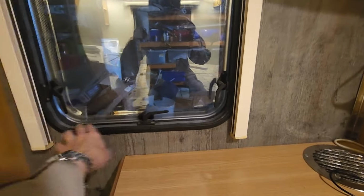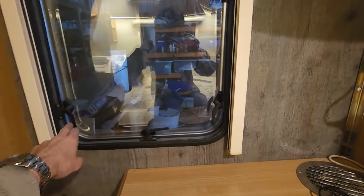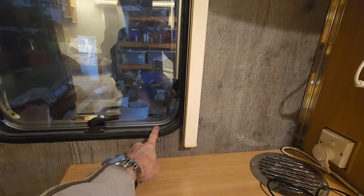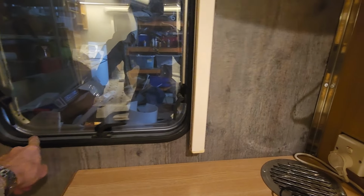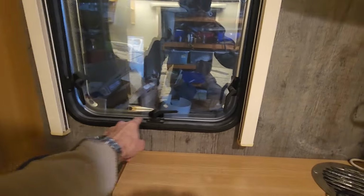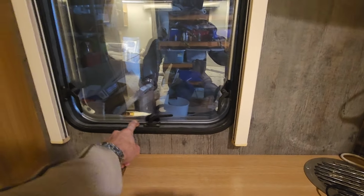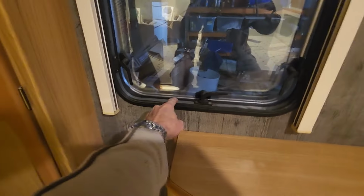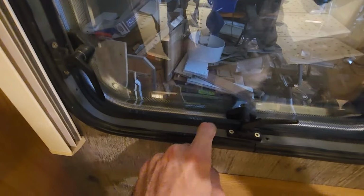Like all the rest of the windows, it had all been overhauled, with the same wooden blocks, and I put the tar-backed silver tape on this one, and then put the rubber seal in, and then laid this inlay in. And these inlays, even though they're just a decorative feature, take an awfully long time to get. You can see just there, see that grey plastic inlay?